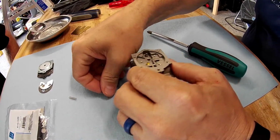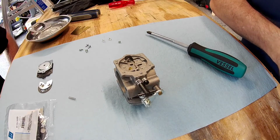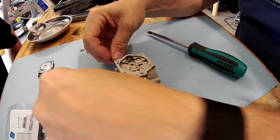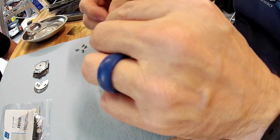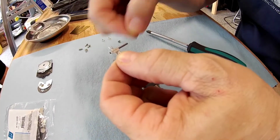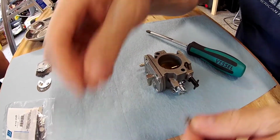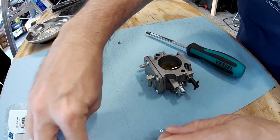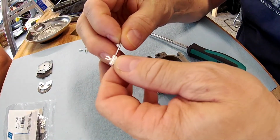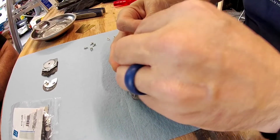But now going together for this side, you've got to make sure. And don't bend or stretch the springs or these pieces. You'll affect the carb's performance. Yeah, you want to be careful with this. This is real thin aluminum, this little portion right here. This little thing is aluminum, and it bends really easy. It is actually used in helping you tune the carburetor, and it doesn't take a lot. It's made to bend for that purpose, and it'll actually bend very easily.